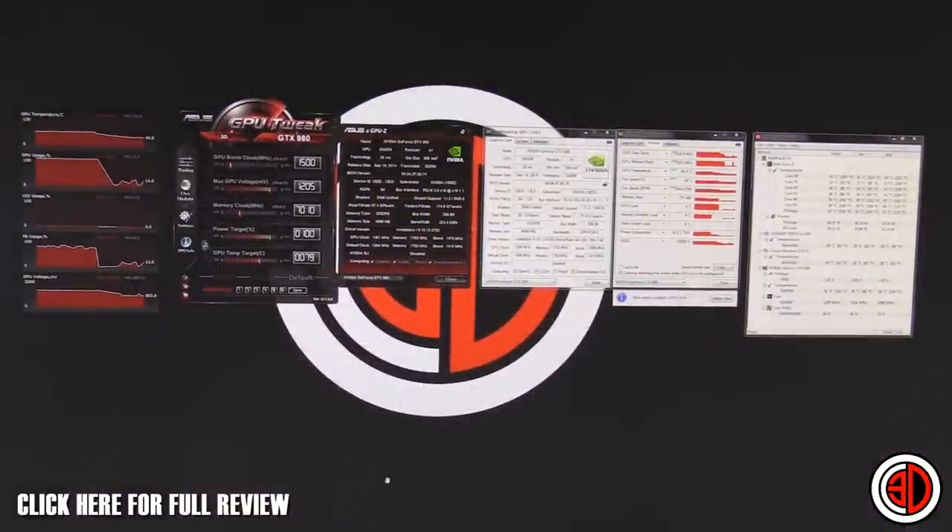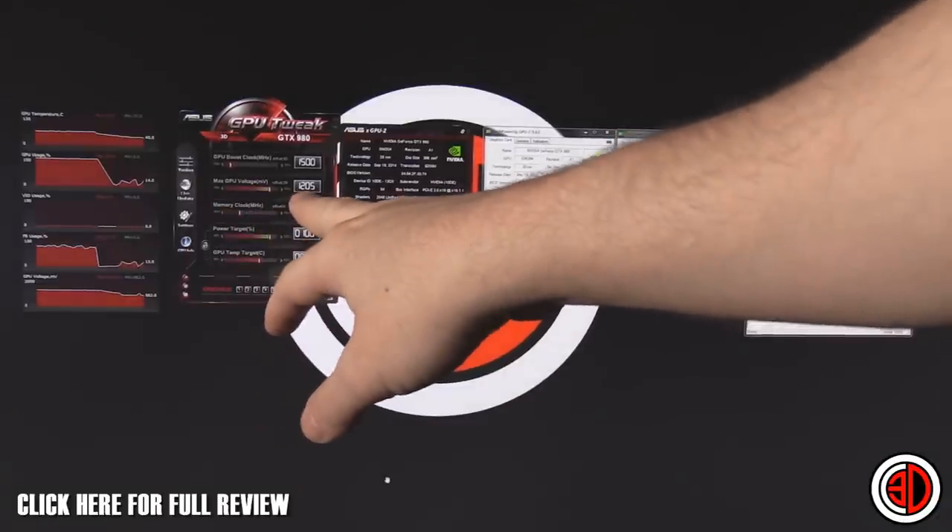Here are the overclock settings. We used Asus GPU Tweak, although you could use MSI Afterburner - it's nice to see the range of stuff we did. We've also got the temperature test for the overclock. When looking at the overclock settings we used, we've only gone up to 66 degrees. The fan speed has only gone up to 55%, but it has gone up to nearly 2,500 RPM. This one doesn't go passive and it's pretty much at 1,200 RPM at stock. Even though it did go up to 2,500 RPM, it was quite quiet, and it has kept temperatures right down.